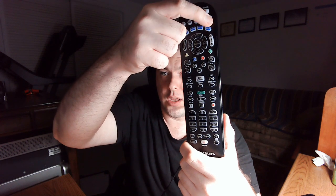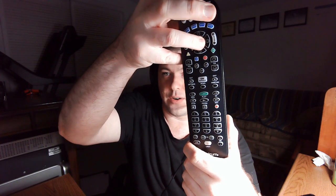I'll put it back to TV since I don't have a home theater in my bedroom. To set it back, hold down cable until steady, hit volume up, then hit TV instead of AUX. Now it goes back to controlling the TV function. Setting up your receiver under auxiliary is manual — it doesn't do automatic volume reassignment.